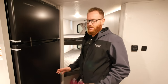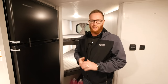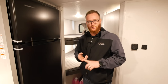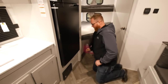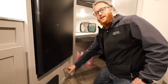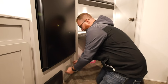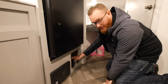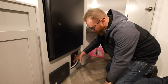Now that we've removed all the water using 20 psi of compressed air, we're back inside the coach looking for your water pump, your winterization hose, and your valve. On this coach it is located underneath the refrigerator. Many brands have started putting antifreeze inlet stickers on the front of the access panels to indicate where your water pump is. After removing the access panel, your water pump is right behind it, along with the winterization hose.